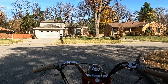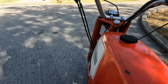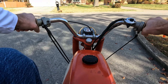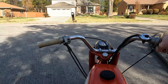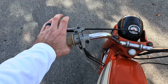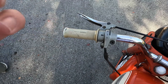I'm going to leave this on the horizon leveling — we'll see how this does. I don't know if they'll notice this is the next day. Transparency. So I can start talking about shifting. I'll just do a loop around the block — I'll do my ten-minute turnaround. Second kick, not too bad. So this — you can see here — here's the clutch, and it's a three-speed manual transmission, but you rotate the shifter like this to go into gear. It indexes it by those notches right there — that indexes your gear position — and the cables change the gears down in the gearbox.